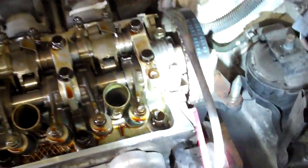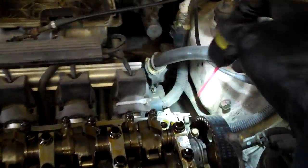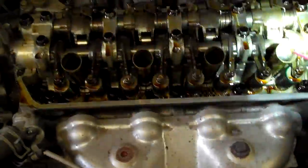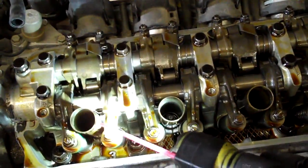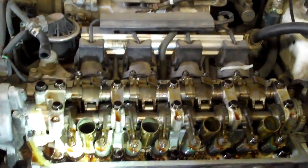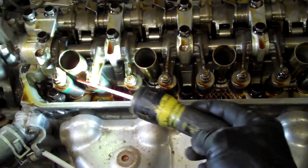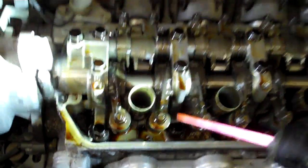For example, if I'm in the down position and my firing order is 1-3-4-2, then down would be four and the next position would be two. So I crack these loose and adjust them — basically you want your valves in the closed position. You can watch and see without pulling the cover off if you can spot that you're in the closed position where the cam lobe is all the way up. When you put your feeler gauge in there, you should feel a light, consistent drag — it should want to grab but not require you to be scraping the gauge. Just a light drag.